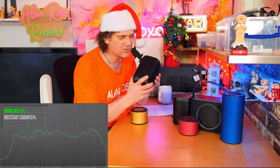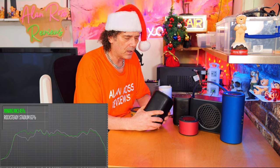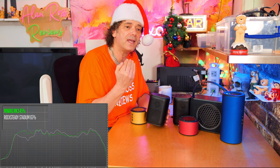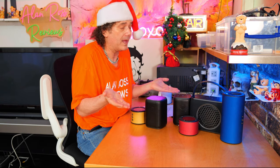There's the thing. I keep seeing videos where they say, oh, it's just on its own, lots of bass. And maybe it did at the time, or maybe they still do. Mine do not have satisfying bass. There is a roll off at 200 hertz. Yes, it does come up a bit again at 50 hertz, but you're not going to hear that. It is a bit rolled off, but it is there. But obviously where the passive radiators are kicking in, it's not like in their measurements. It's not like people are describing. I have to put that.